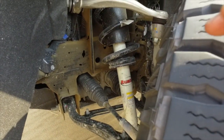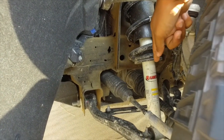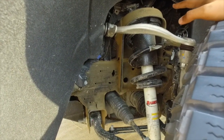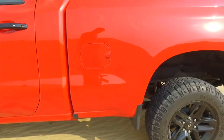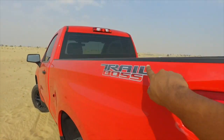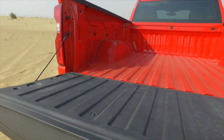What's different about the Trail Boss: you've got a two-inch suspension lift. There are no body spacers here — it's actually a taller spring and a longer shock. These are Rancho shocks; they look pretty basic but seem to get the job done. There's a slightly different alignment as well. At the back you've also got a bit more lift, no different springs but again those red Rancho shocks. Otherwise pretty much your standard Silverado — and you get this Trail Boss sticker, which is quite cool.